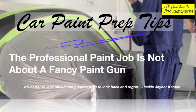You want to get silicones. Silicones come from wax. Anytime if you wax your car, you're going to have silicone on there. Just from the environment, driving behind a diesel, it's all over. Using Armor All on your tires or your interior, the silicones become airborne and they stick to your paint. And it's necessary to get that off. And if you don't, you're going to have problems like fish eyes when you go to painting. You may have paint failures, just a lot of problems that's not necessary. These can be eliminated. And you want to wash it. Wash anything that's going to be painted really, really good before you start.